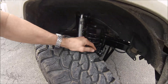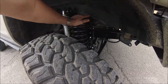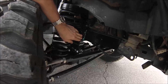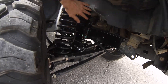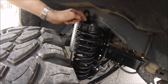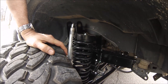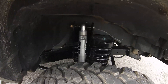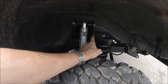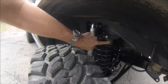On this particular model, we tried something new. We added a cup right here to help keep the coil spring centered on this bracket. These coil buckets are adjustable, and you can take these bolts out and raise or lower the ride height of the truck. There is a capture plate in here that bolts down and grabs the top curl of the coil. That works pretty good, but we've noticed that sometimes the coil springs want to scoot out off the edge of this bracket. So these cups should prevent that, and that might be something we're going to do on future builds too.